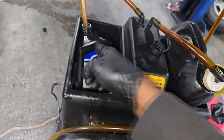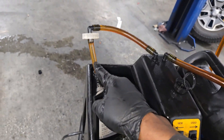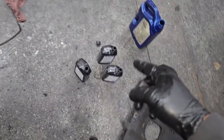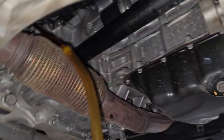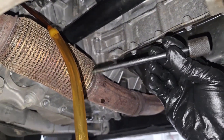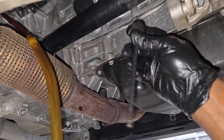When I click on the machine, it's going to suck fluid out of the jug and travel it up through the hose into the transmission. Alright — that was my last quart. As far as the amount goes, I put in four quarts and a half — actually a half quart as well. It's not technically spitting out, but that does not mean it's full. Here's the sure way to tell.